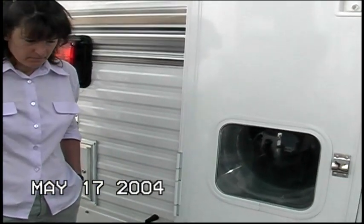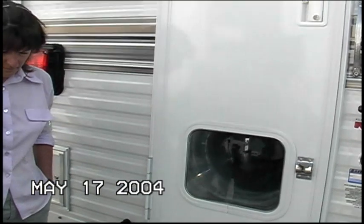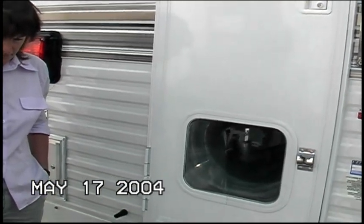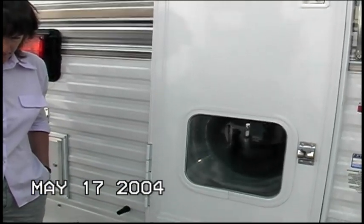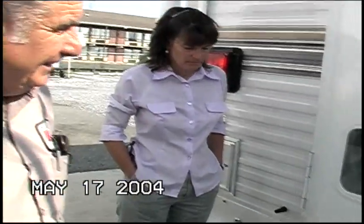So what if you don't drain them down? Is that gonna be a real rough ride? It's gonna be a rough ride unless you dump some of the air out a little bit. But you got no less than 5 pounds and no more than 100 pounds. He'll tell you more about that when he loads it. When we load it.